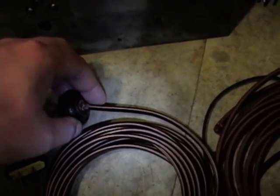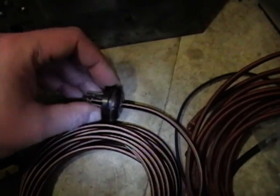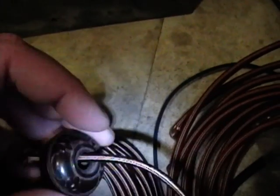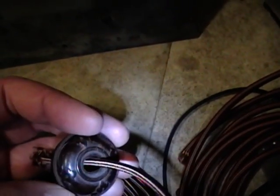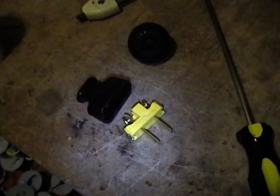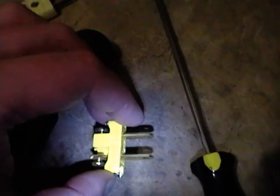I'm not sure about a strain relief, though. This cord will fit through that hole and there's quite a bit of slack there — so I'm not sure how that would have been secured in the old days, or did they just leave it flopping around like that? Okay, I see how this type of plug works now. You loosen up these two outer screws and this whole yellow section slides out. This is where you attach your two AC lines, and the assembly goes back in, and you tighten it back down.